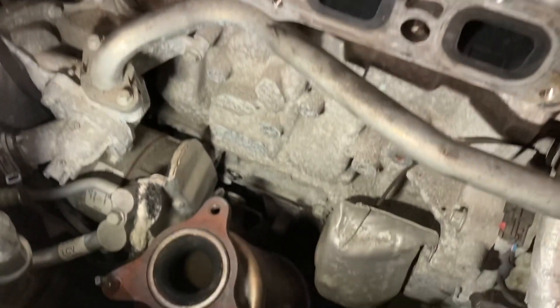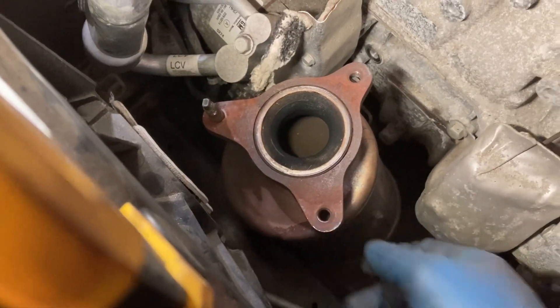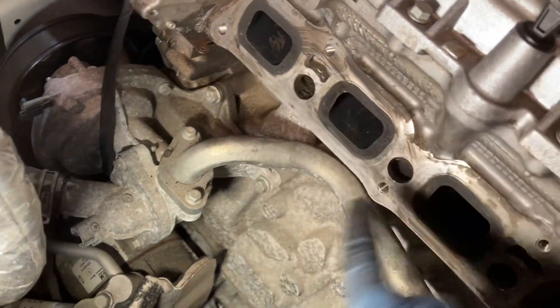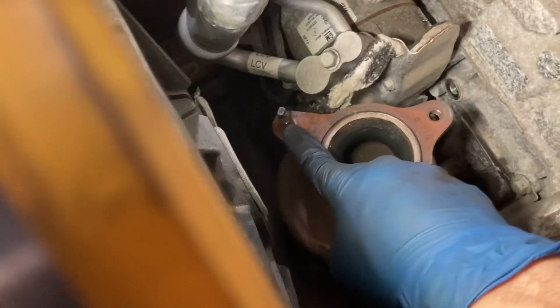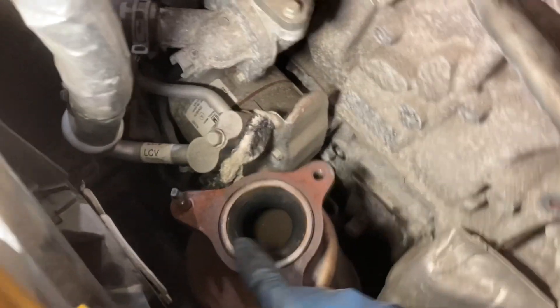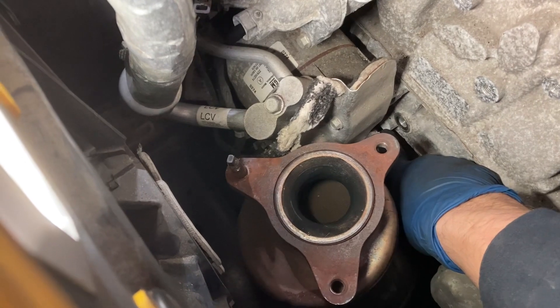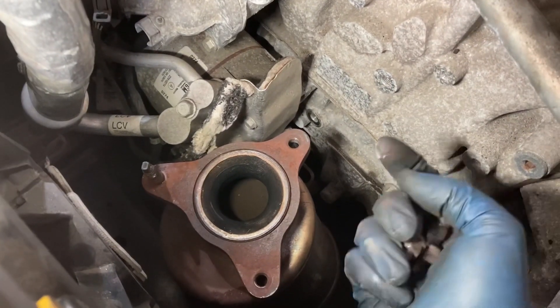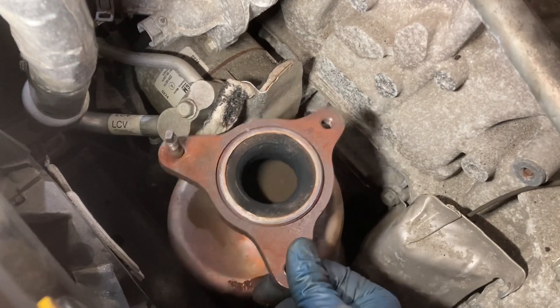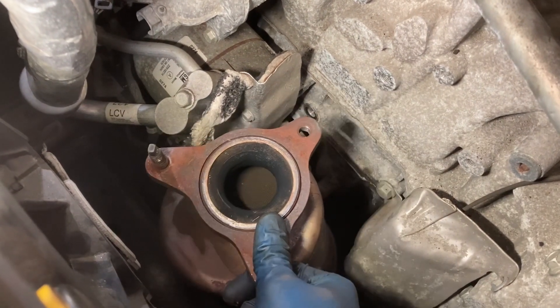With the manifold out and plugs removed — if you're lucky you might get the whole stud in the catalytic converter out with the nut, in which case you can just unbolt. There are five 13-millimeter bolts holding the manifold on and you can just take those out and the manifold lifts straight off. But if you have a stud, you'll need to drop the exhaust down because the stud will be in the way. Go under the car — there's a 15-millimeter and a 13-millimeter just below it, and one more 13-millimeter on the oil pan. Those hold the bracket holding the cat and the front section of the exhaust. Once you take those off you'll be able to drop it down — just let it down gently.